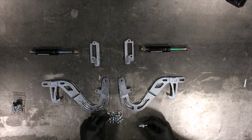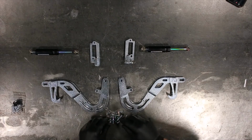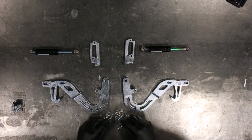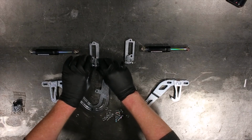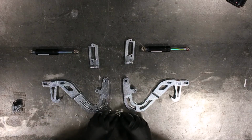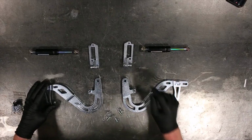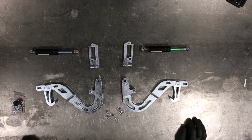and your ball ends are going to be what you want to install first. Basically you want to work in pairs, so you want to finish this, let's say the right side first, with the matching nuts that are provided in the kit, like that. So this is before tightening everything up. Basically you can see how everything's mirror imaged. The ball ends are facing up and outwards. Now we can go ahead and tighten it up.